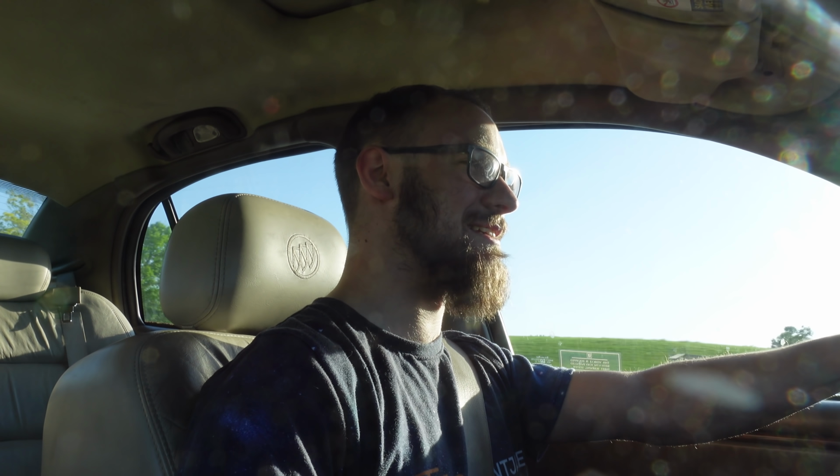This is the nicest riding one of these cars I've ever been in, LeSabre or Park Avenue. But also what the functional air shocks did for me is this squats a lot less now when I take off. So hopefully I should be able to hook a little bit better, because the shocks will now be resisting all that weight transfer away from the driven wheels.